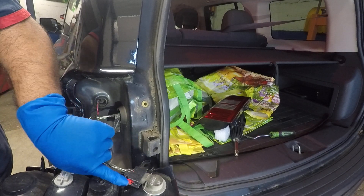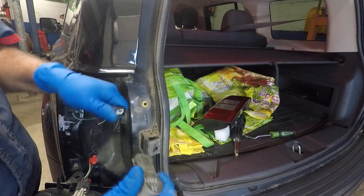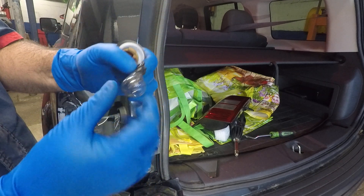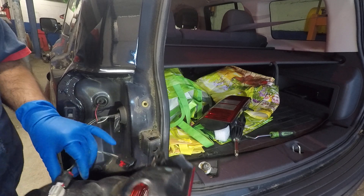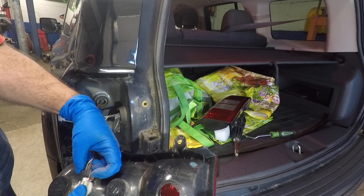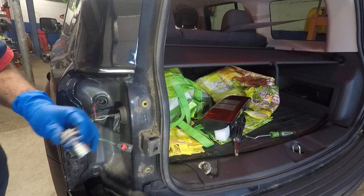This guy comes out. The whole bulb came out. This is how this connector comes out. So if you wanna replace the bulb, you just turn this clockwise and pull the bulb out. This is a dual filament bulb — versus the brakes and headlight, you can plug it either way. But make sure you get the correct bulb. We got a second one here — same thing. Red little tab, push it back. Or we can just turn the whole thing here and get this off.